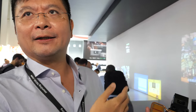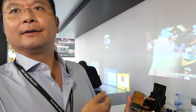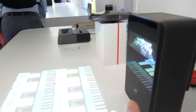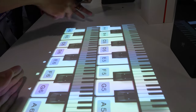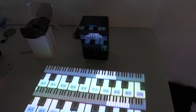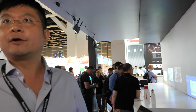So it's a very sophisticated tooling and also coating, reflective coating on the plastic component. And so the whole point of doing short throw is that you want the focus to stay good from here to there. Exactly. And then you see the distortion, there's no... No distortion. It's just perfect. Right. Because the touch needs to be aligned with the image. So any distortion will cause problems.